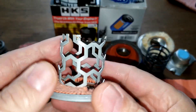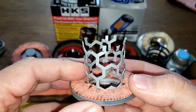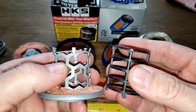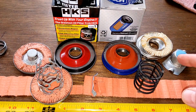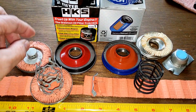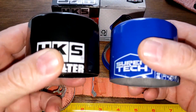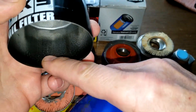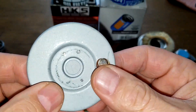This is what the HKS inner core looks like — a strange metal inner core, never seen one like that. These filters kind of equal out on flow. You've got a stamped leaf-spring bypass on one and a different style bypass on the other. The base plates and gaskets are pretty much a tie. The HKS wins on can thickness, but you can see all the overspray inside it.